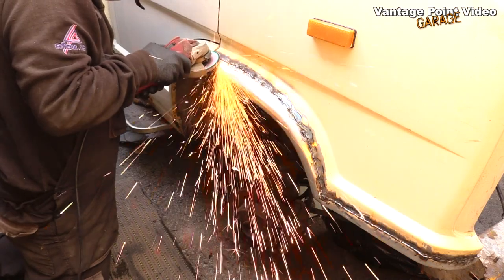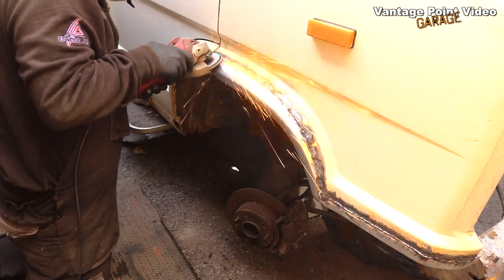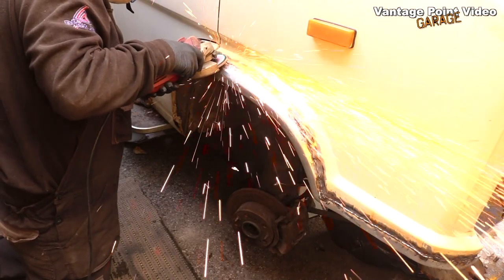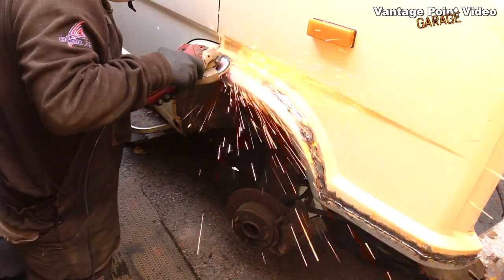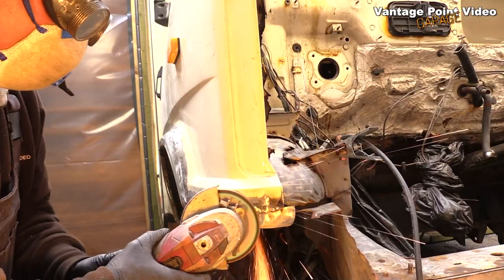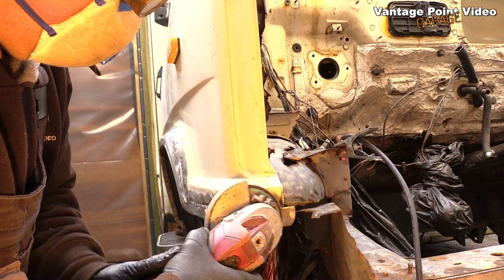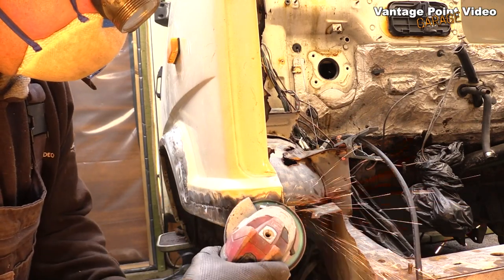There was some bit of warping from the continuous weld, but it was concave, so I'll be able to put a light skim of filler over this to make a very tidy repair in the end. After all the stripping down on the camper, I'm really pleased to have done something constructive, and I can already feel this new structure coming back into it.